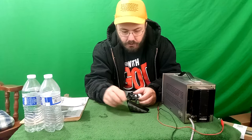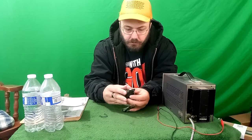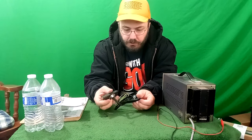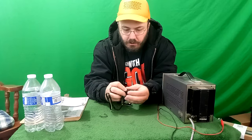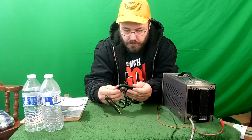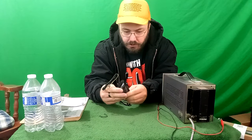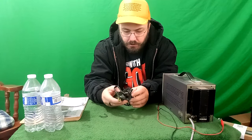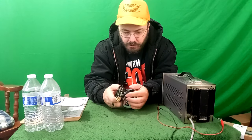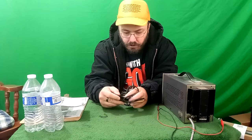They basically got a bolt in the back with the wire like this. What you gotta do is you can take the rubber piece off if you want to, or you can leave it on when mounted — it goes around the outside. It's probably better to put it on, and you might want to silicone it. You've got this washer and this nut to mount it. So you need to drill a hole that's the size of these threads here, put it on, and you're good to go.